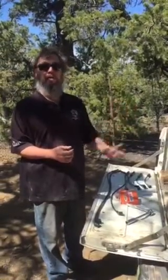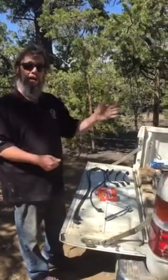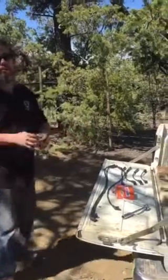So we'll go up to the front of the truck, pull the first plug, pull that wire, come back and match it to the length and make sure I'm getting the right wire back there, because all too often I think people take all their plugs out, get all their wires off, and then you're like, well, where the hell does this wire go? Well, it's a pain in the butt because all those cylinders have to fire right, and if the wrong plug is going to the wrong wire, then you've got an issue.